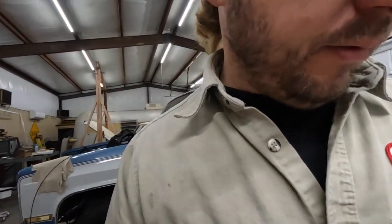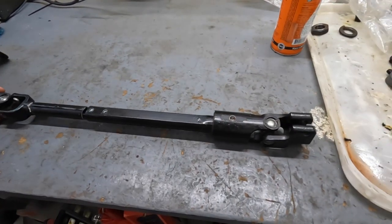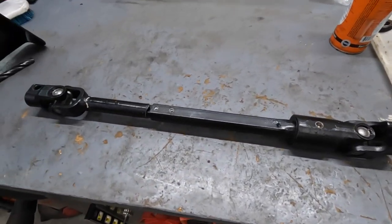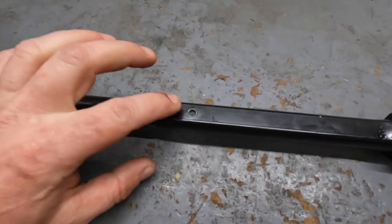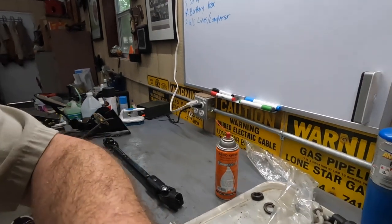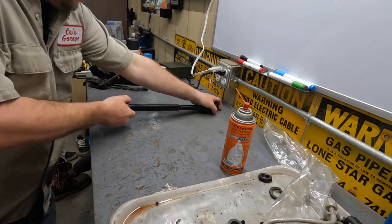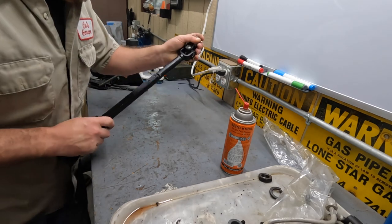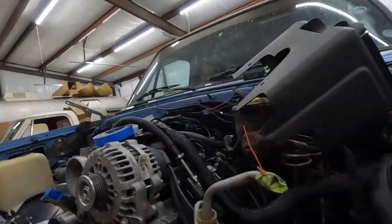Alright, back at it — it's a few days later. Finally got some parts in. Got the steering shaft for a Jeep Cherokee, like '84 to '90 something. I'll put the exact details in the description. It had these spot welds which I drilled out so I could tap it down because it was too long. I'm going to see if I can pull it back out — I may have to use mechanical force since I tapped it a little further in. Let's just drop it into the steering gear and see.